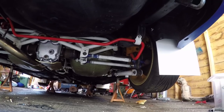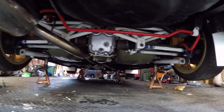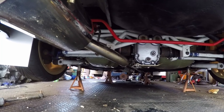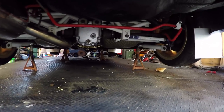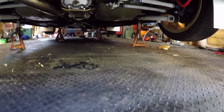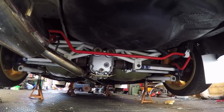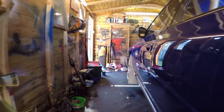Underneath the car there's adjustable lateral arms and adjustable trailing arms, plus a fully tubular WRC-designed subframe. There's an under-tray still fitted. The car is fully guarded underneath with Kevlar guard on the fuel tank — required for the MSA logbook. It's also got a sump guard, a gearbox guard, and a rear diff guard. The side skirts are also Kevlar. The small holes in the side skirts are for sill stands, used in rallying so you can jack the car up on dedicated stands rather than axle stands.